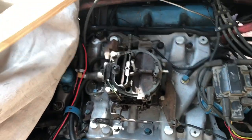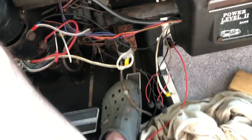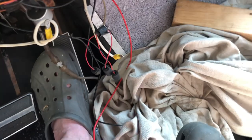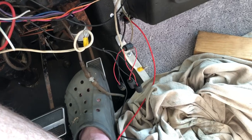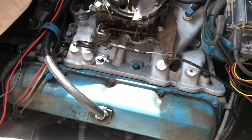We're back in action - this video is so chopped up at this point. Anyway, I put my distributor in and put everything back together. What I think I'm going to do is take my gauges out because it's a mess and I want to put new gauges in. This wire here is my charging wire and it's hot when the engine's running, so I think if I put that on my new electric choke then I'll run a wire there - it's a bit of a mess right now.